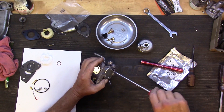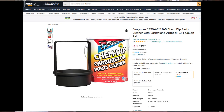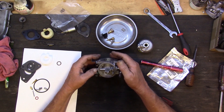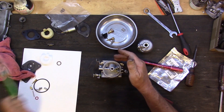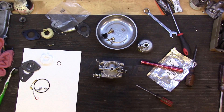Make sure the thing is sparkling clean. Use an air hose and blow through all the little holes gently. I use Berryman's carburetor cleaner — the stuff is real good when it's brand new. Even if the metal can is several years old it'll be fine, though the can will rust and leak before the cleaner goes bad. Let it soak about 20 minutes, scrub it with a toothbrush, blow it off, then dip it in a bucket of water and rinse it — you'd be surprised how much more dirt comes off after the water rinse.